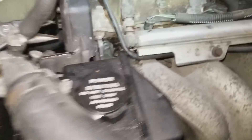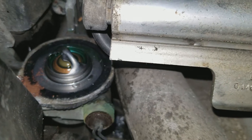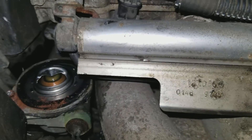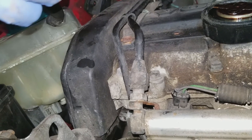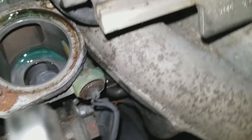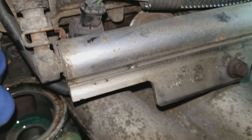So it is time to do this radiator — having a hard time getting one today, may have to wait till tomorrow. It's not an OEM thermostat, it's an aftermarket thermostat that's been leaking a little bit. I just don't play with aftermarket thermostats anymore — they're not worth it. I'm gonna get this thing out of here, clean it up, put the Volvo stat in. I never want to put a thermostat in that can lock up and overheat the car. Looks like I'm gonna have to put some PB Blaster on there — also looks like somebody put gasket material on there when they put that last thermostat in, which is never necessary with the Volvo one.